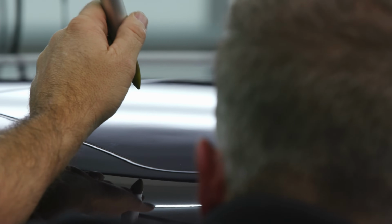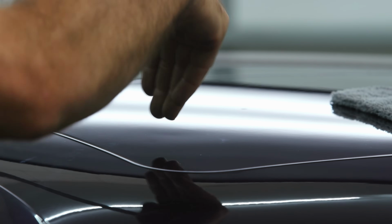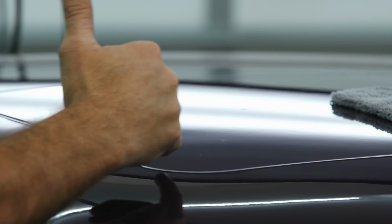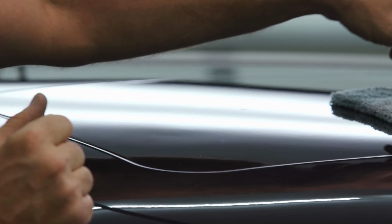What I'm doing right now is I'm actually just bringing down not the high spot that I created, but some of the edging of the orange peel. Out here was a little bit of a high spot that occurred, if you think about it. It got dented, and the metal eventually had to go somewhere. It vibrates, it makes its way out to the edge here. It's more structure here, this is less structure. Metal shoots up, high spot.